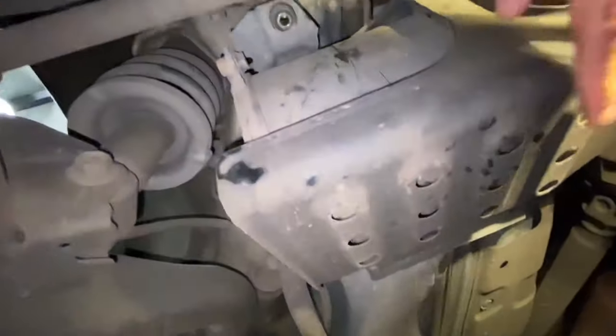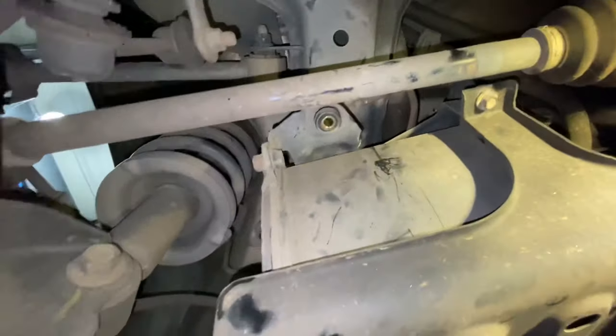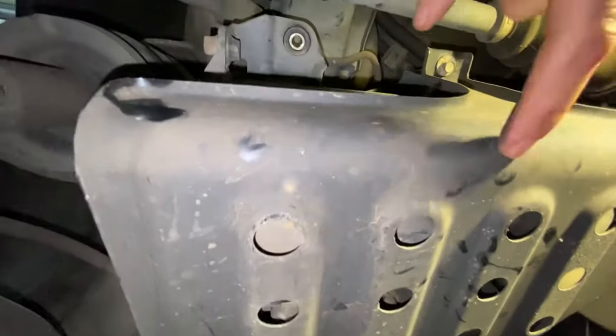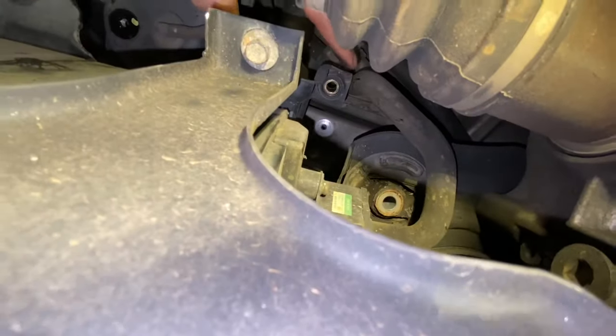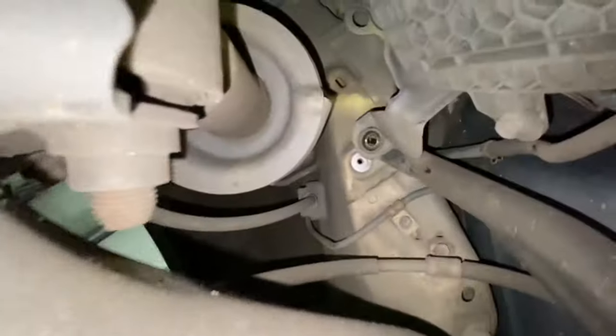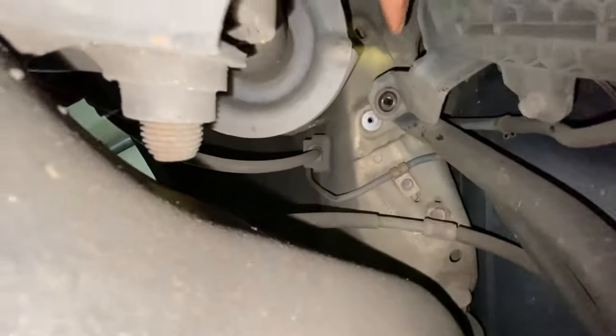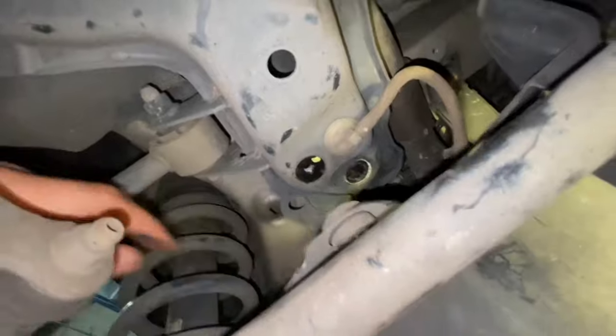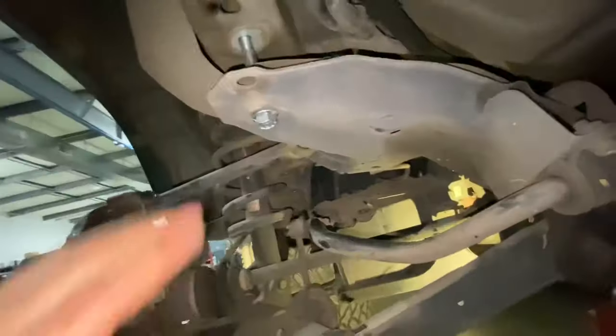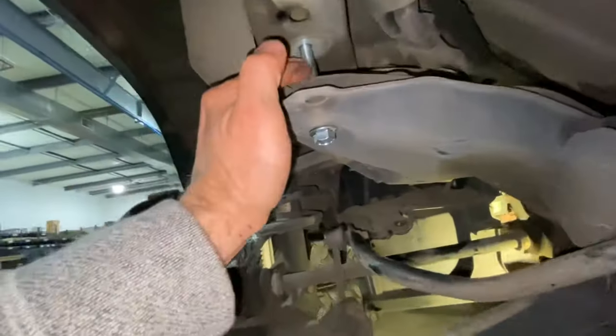You have to remove this charcoal canister right here. To do so, it's basically just a couple of bolts — there's one here, and here's the skid plate on the bottom of the charcoal canister, just leave that on. There's a bolt right there and then there's another bolt right in here, those two, and then there's one more on the side. Moving that out of the way allows us to get access to this bolt right here. Remove that and this bolt here and lower the whole subframe down enough to get a spacer in.